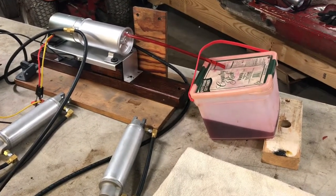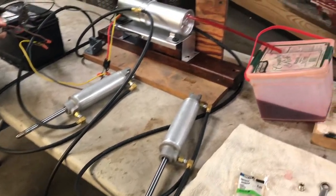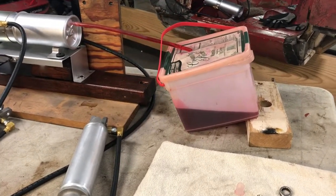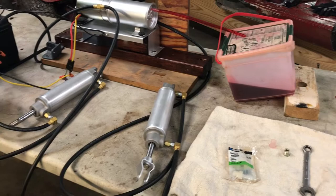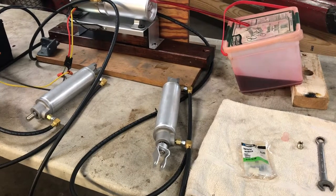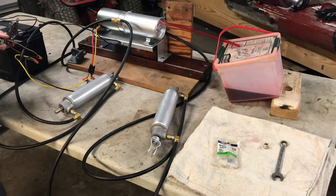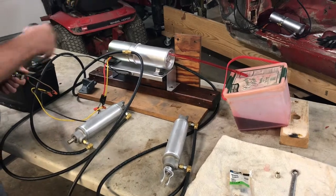Notice that it has drawn fluid. Now we've got another cylinder going up. Once it goes to the top, we're going to stop, come back down, and you're going to see this burp right here. I usually leave it set five to ten seconds between burps — that way any air that's got to come out will come on out of there.